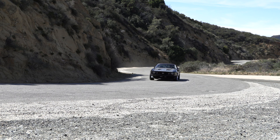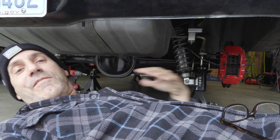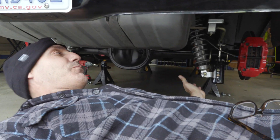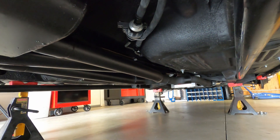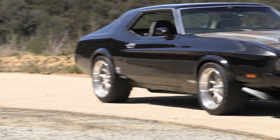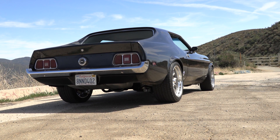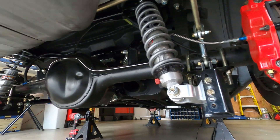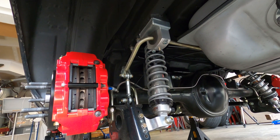One of the things I'm really proud of is if you notice the underside of this car — it's pretty smooth. You don't have the exhaust dangling down. Even where the X pipe is under the transmission, everything's very tidy. The things that stick down the lowest are the two subframe connectors, and that's just the kit I bought. In hindsight I probably should have made some or got a little bit tighter ones, but other than that it looks pretty good under here.